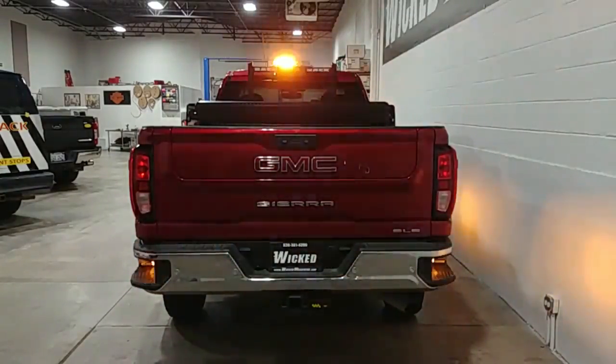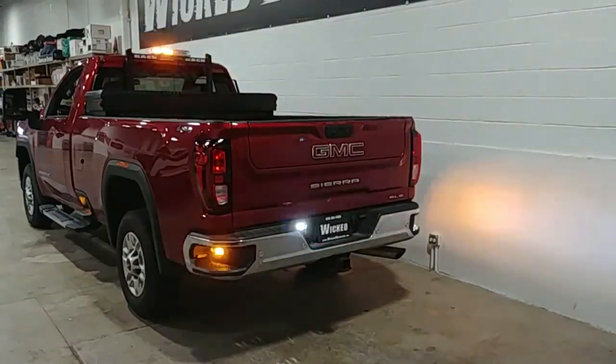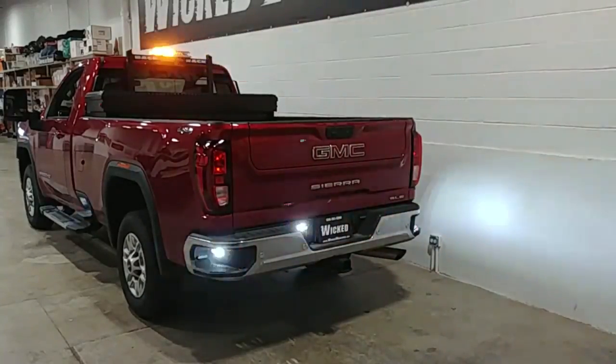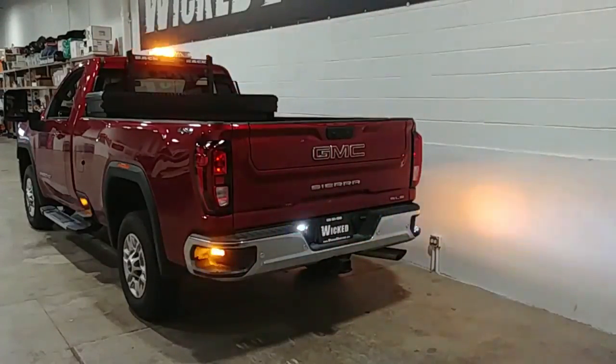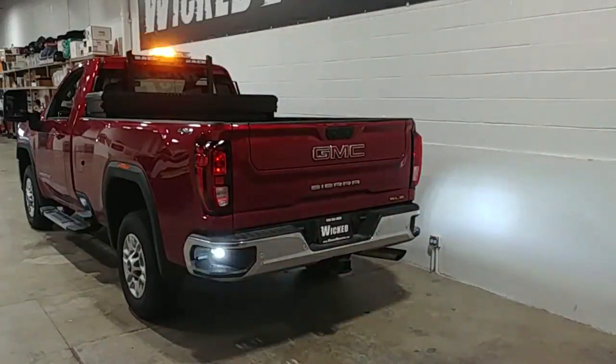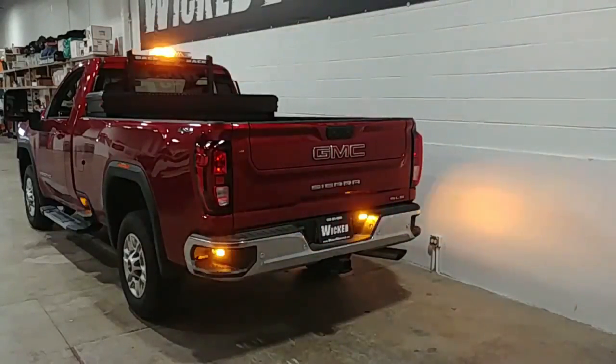When you're behind the snowplow truck, that's where we want to be the most effective and most aggressive. We wanted everybody to clearly see this vehicle, and the customer requested we really light it up so he didn't have any issues with people behind him not being able to see him. The other reason is we didn't want to create too much conflict with the side lights. By doing a faster flash pattern on the small SoundOff, it allows the slower pattern on the Thin-X that's next to it — primarily side-facing — to also show off pretty well. You can't synchronize the SoundOff to one of our Thin-X's, so we had to go with a contrasting pattern so you could pick up both lights and they both work effectively. Now you can see how well the rear M-Powers work joined together.